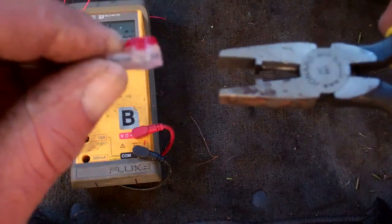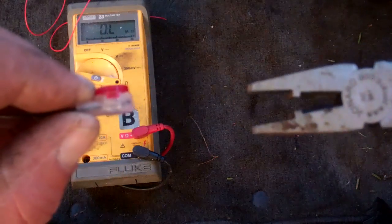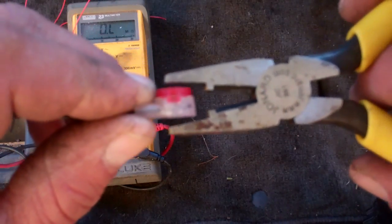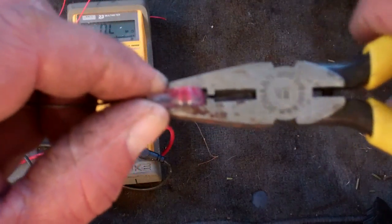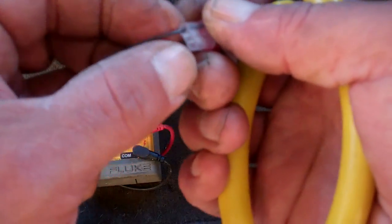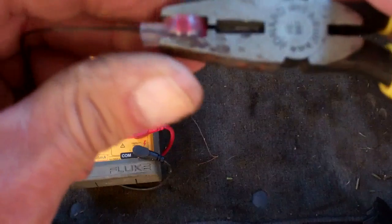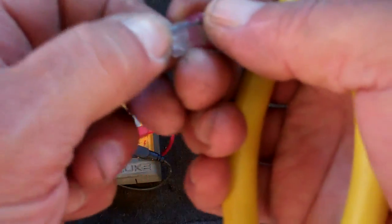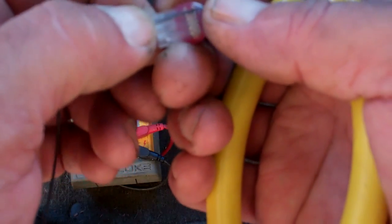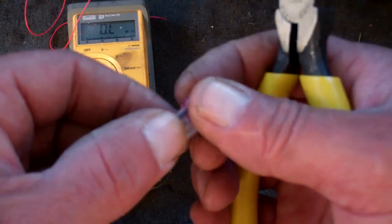Now there's a proper tool for it. I've used pliers in a pinch, but the beauty of the proper crimping tool is that it lays flat on the scotch lock connector, and as you compress it there's actually insulation inside — a dielectric insulator — and that fluid will keep a nice clean connection in there.